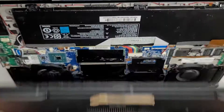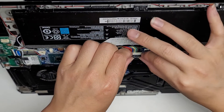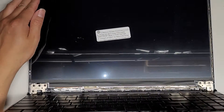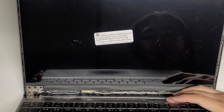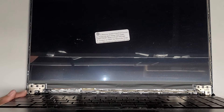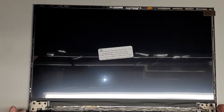I'm going to flip this over, pull the bottom cover back off, and reattach the battery connector. Let's go ahead and power it up. It's turning on. I don't see any backlight at all on here — I do see some screen coming up, I do see the Eluktronics logo, but there's no brightness at all. It turned itself off.